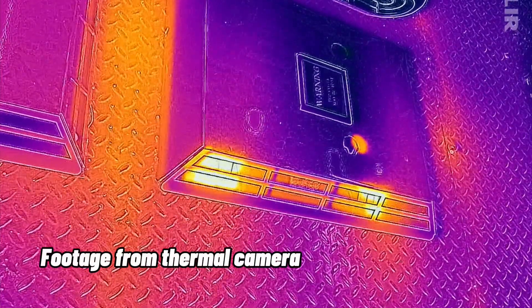We saw an internal motor core temperature of 170°C — at 180°C we start to see a derate. Oil temperature going in and out of the motor was 65–70°C, so we were not even close to the point of shutting it down. The dyno plates, however, were glowing red. The car was still pulling through the load and was basically just fine with it — the dyno was not. We've been shutting down before the dyno says it needs to stop. We also got a little bit of Dexron 6 coming out of the dry sump tank vent — might have had just a little too much in it — but the car is performing great.